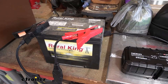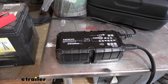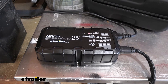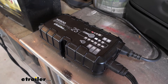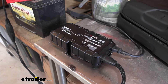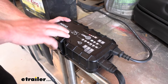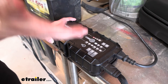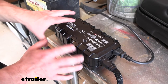One of the nice things about the NOCO Genius Pro 25 is its multi-stage charging algorithm that charges two times faster than regular chargers without overcharging or damaging your battery — it hooks up, analyzes the battery right away, and gives it a customized charge to get it done as quickly as possible. It can charge 6-volt and 12-volt batteries up to 1,000 amp hours, or 24-volt batteries up to 500 amp hours. The supported battery types are wet cell, gel cell, enhanced flooded, calcium, maintenance-free, AGM, and lithium-ion — though lithium-ion batteries must have battery management systems. The whole NOCO charger is made from durable resin, so it's rugged and waterproof, good for onboard and off-board applications.